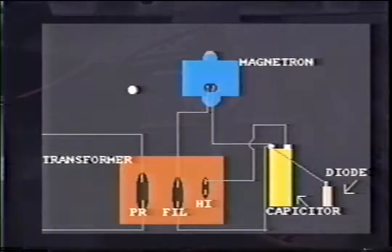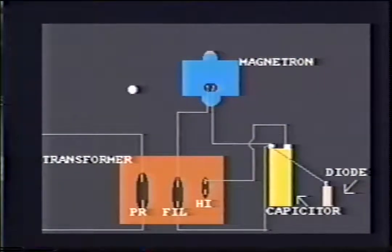Okay, let's recap the high voltage system. First, unplug. You should be able to diagnose everything without any power. Next, make sure to get a screwdriver in between these two leads of the capacitor to short it out. Discharge the capacitor. Next, it's just a process of elimination. We check one at a time. The diode: put one lead here, say a red lead here, black lead here, you should have a reading. Switch it around, black, red, should be open. In other words, the electricity just flows in one direction, which is down towards ground.